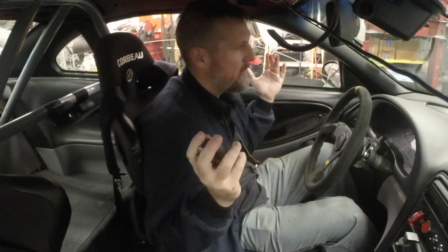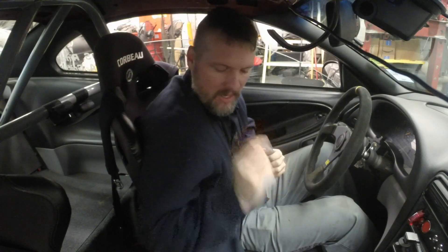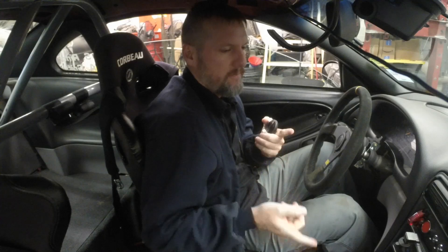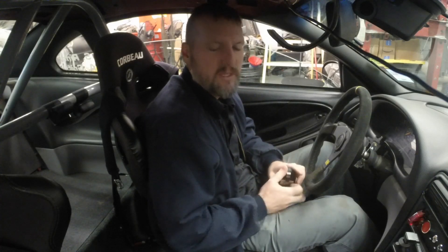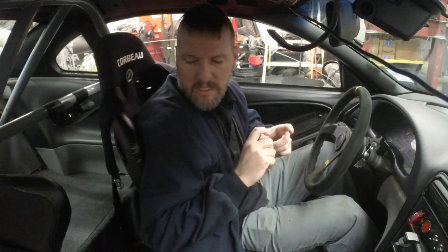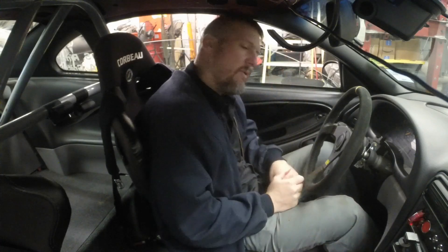That ends this video, the rear end is working. I still probably have an issue in the transmission. I think I'm going to pull the driveshaft — it's an aluminum one; I replaced the U-joints on it and replaced the bushing in the tail housing of the transmission — but I think I'm going to pull it out and take it to a place to get it balanced and see if that helps at all. It's been in there for about 10 years and I likely bought it used, so there could be some out-of-balance with it. I've tried rotating it on the pinion flange, but it's only in fifth gear, so I think it's the transmission. Thank you guys for watching — we'll see you in the next one.